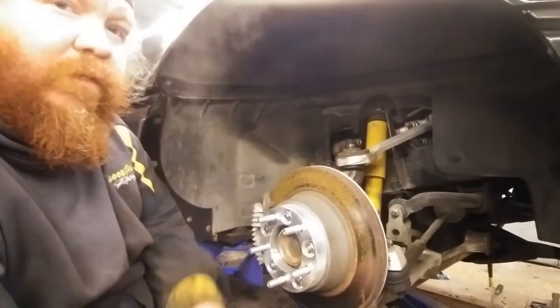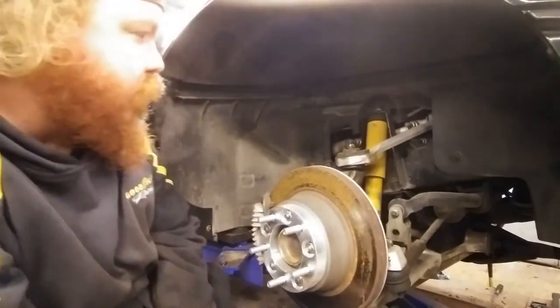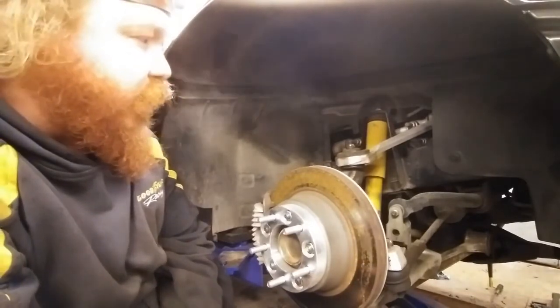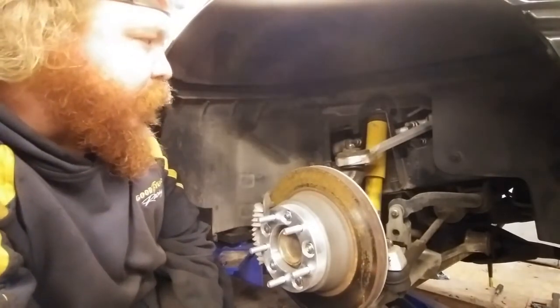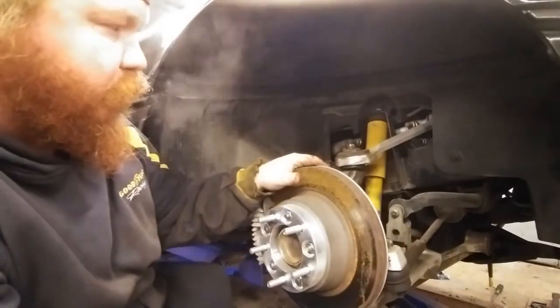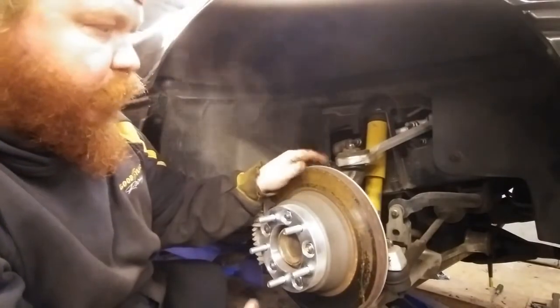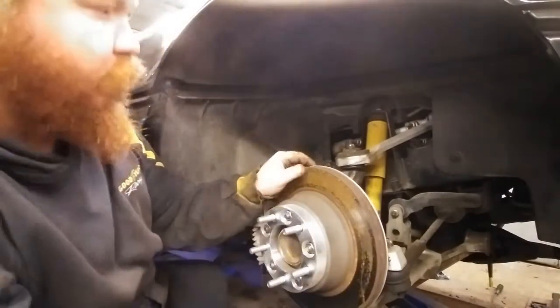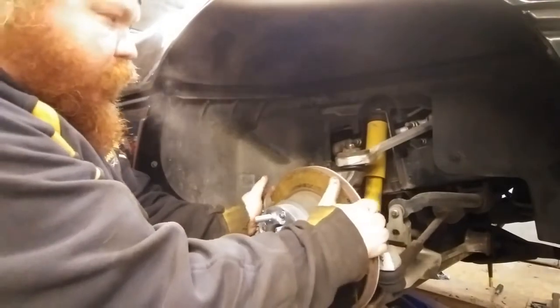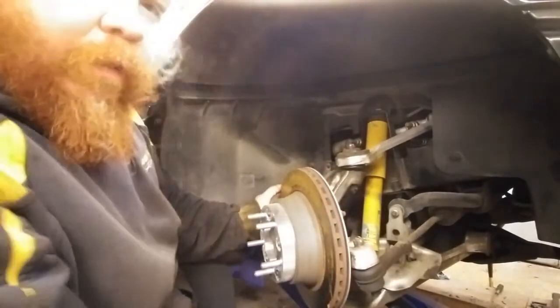I have a new material that I'm going to cut out and make a pad out of that I'll show you guys, and we'll see how low I can get this thing. I did take a measurement between the top of the tire and the bottom edge of the fender before I started - that was 2 and 7/8 inches. We want to tuck this thing down over the tires as much as possible, as inexpensively as possible.